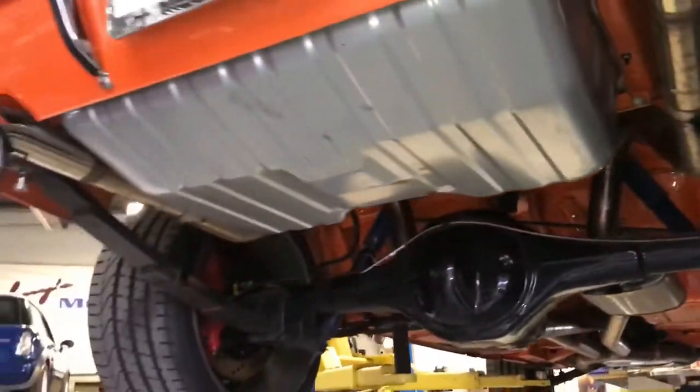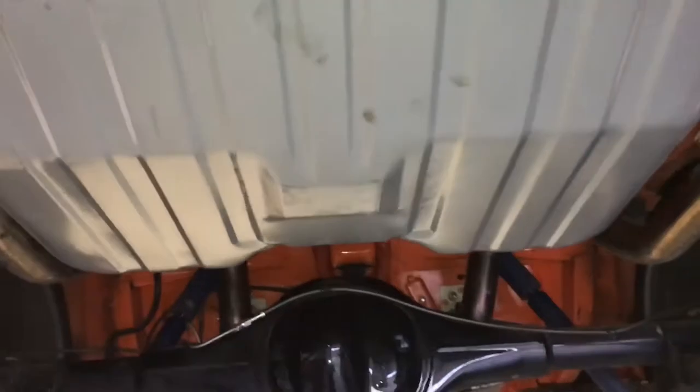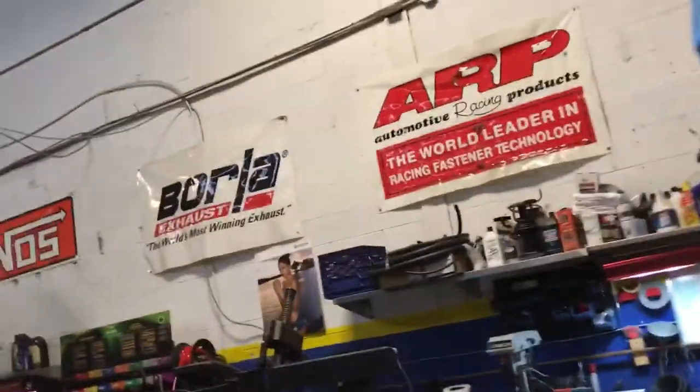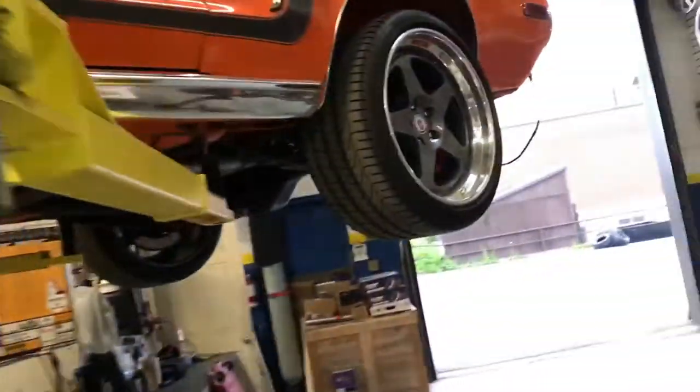And basically, this is the tank, and it's a little bit dirty. I gotta clean it up. But basically, so you guys understand, it's turning this from a regular 7-8 psi tank into a two-way fuel injection tank, which allows up to 70-80 psi.